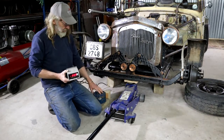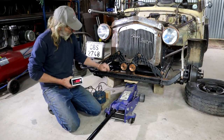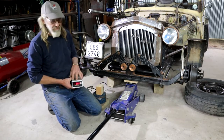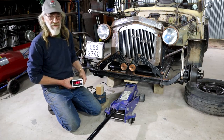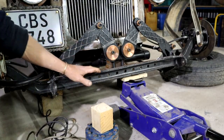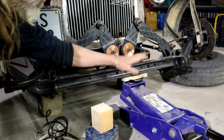What this will do - it's essentially a scale, a heavy duty scale. The plan now is to put the complete weight of the front of the car on top of the load cell, and we will be able to measure quite accurately what it weighs. I've taken the front wheels off, so the complete front of the car is resting on the jack at the moment, which means if I lower this, it will drop.